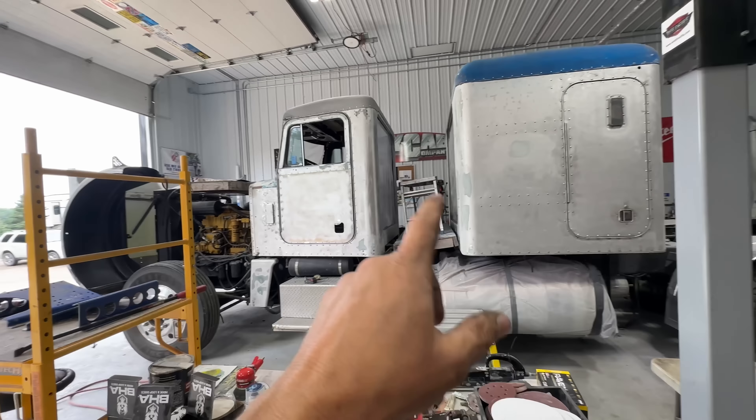I'm really hoping this is the one — Montana Big Sky Base Coat. Something that's just so cool about that. Now, base clear — as I mentioned, I did single stage on snowman. What single stage is, is it saves you a few coats because it's got the base color and the clear coat mixed together, so you put them on both at the same time and only have to paint the truck a couple of times. But base clear is a little different, and I think you get a better result. It allows more flexibility when adding metallics and pearls to get that new car look — you look in the sun and it changes color. That's the pearl and the clear coat. This being base, it's going to go on more matted — almost like the primer — and then the clear coat afterwards just makes it pop.